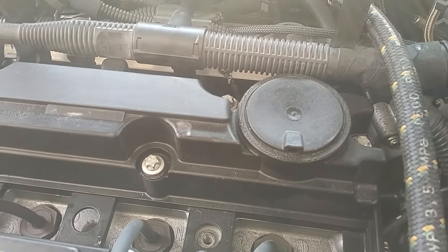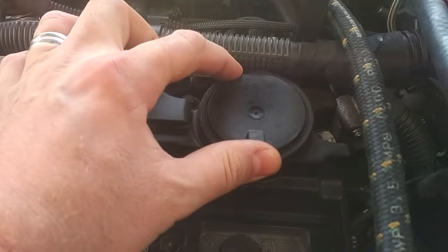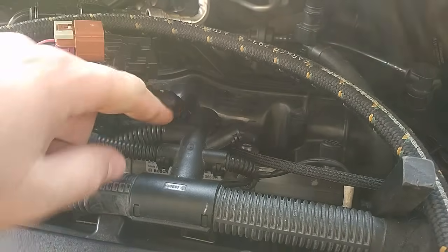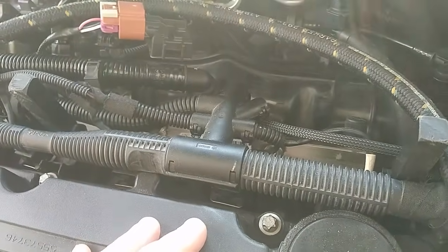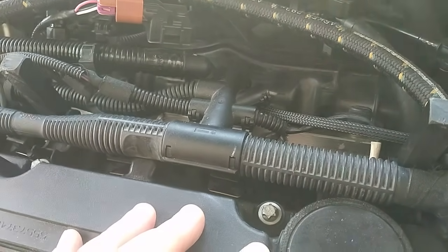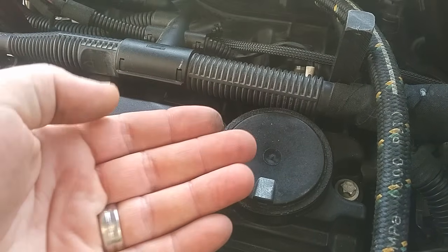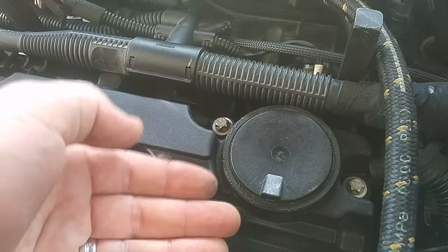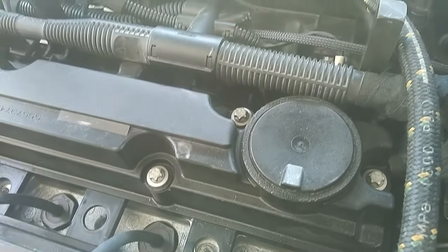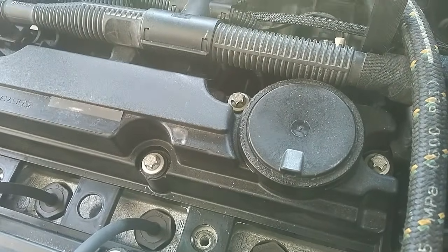It's important to know that — it's not a lot of vacuum. This basically has a little rubber disc inside with a spring underneath it. When the intake manifold produces vacuum — when your engine is decelerating, or when you're not producing much power, or when you're just cruising — it basically will pull this diaphragm down. As it pulls it down, it restricts how much gas can flow through it. It won't close it completely, but it'll limit the amount of flow so you maintain vacuum at between 11 and 18 inches of water.